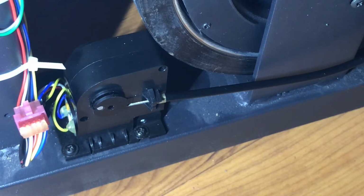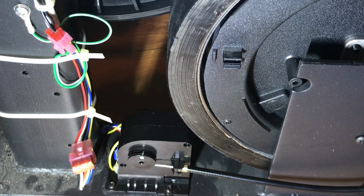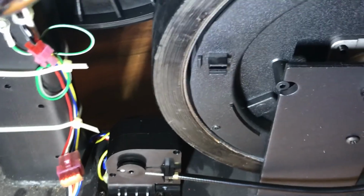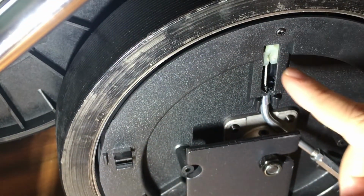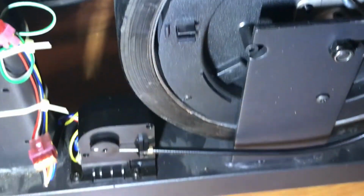So now let's test this thing since everything's put together. I'll turn up the resistance. And look at that. Changing by itself. And so this is on the highest resistance setting, and the way that I know that, obviously besides being the one that changed it, is you can see here, at least when it comes to the actual magnet, you have the flywheel now. The magnets are the closest to the flywheel, so there's the most resistance, and there's the least amount of slack in the cable.